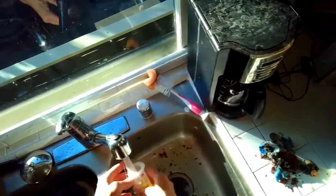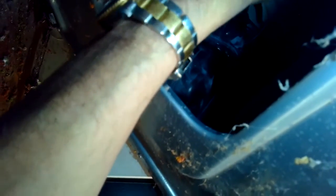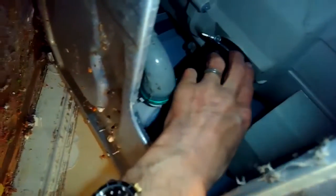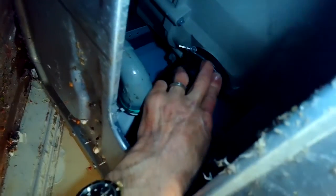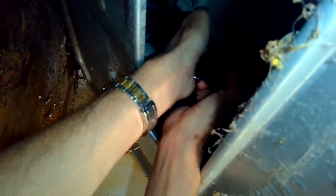I'm just rinsing that, then I'll come back and put it back into that large rubber hose, push it down inside, and get the hose back up onto the tub. I'll put the clamp back on and tighten it back up — just take your time here. There's a little access hole at the bottom of the washer; a lot of front load washers have this, which makes it easier to get to.